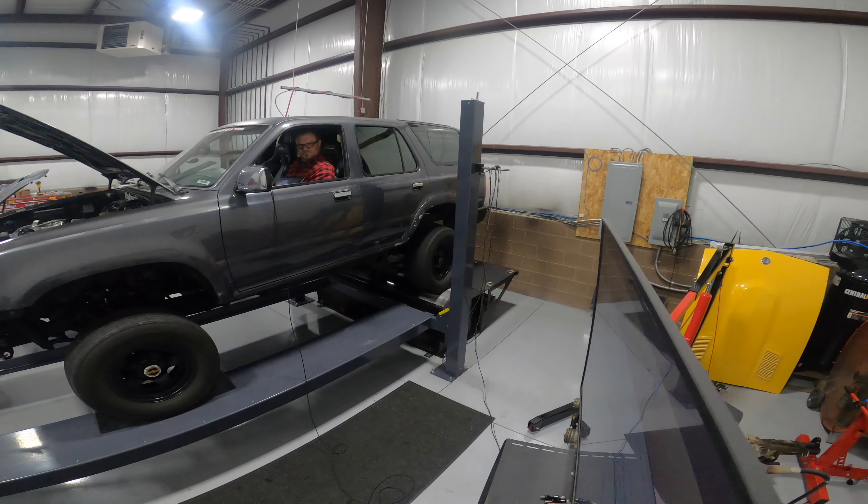It's liking that — it's still running fat too. Let's change the plugs. You hear it starting to break up at the top — just threw a new set of spark plugs in it. Check the log, lean on the boost controller a little bit, turn it up some more. Personal best in this truck is 655 to the tire and we're creeping up on it on 32 pounds — and he races right around 36 to 38.